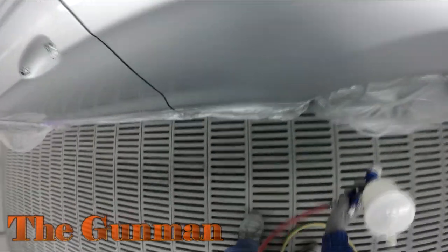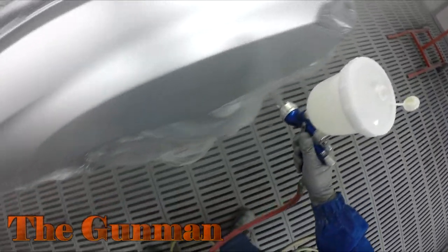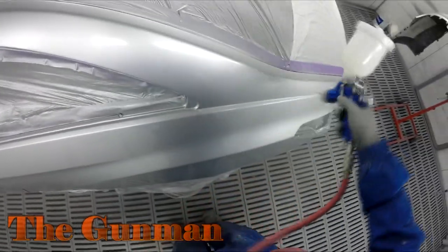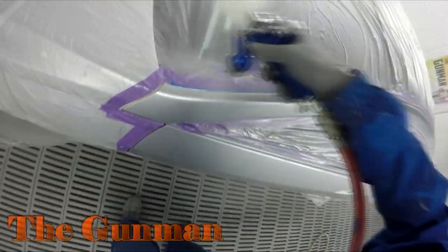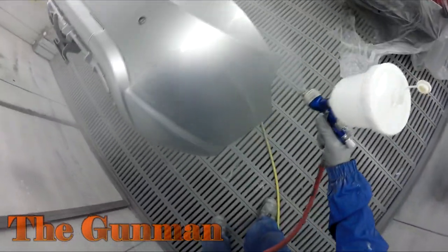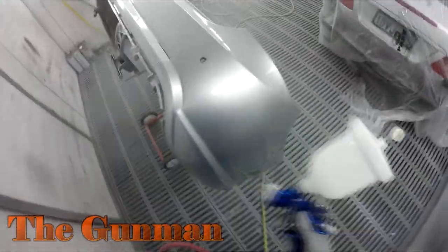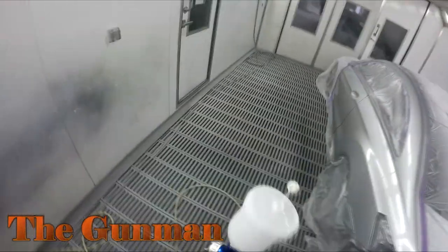Settings I'm using: full fan, four turns out on the fluid, and a touch under two bar of pressure. Previously I was using right on two bar with the Chromax VOC clear — the 3760S. This clear isn't quite as good, but it's still a nice clear if you know how to use it properly: don't overload it, observe your flash-off times, and you can get good finishes with it. Perfect for everyday refinishing. The way that paint was underneath this job, this is a ten-times improvement over whatever was there before.